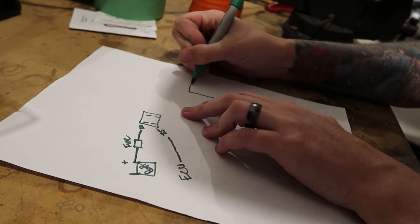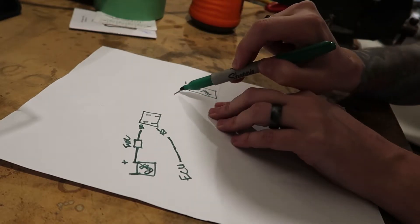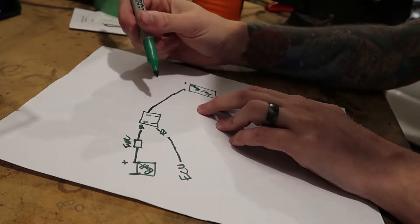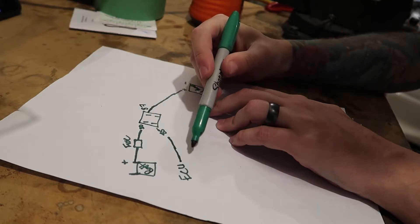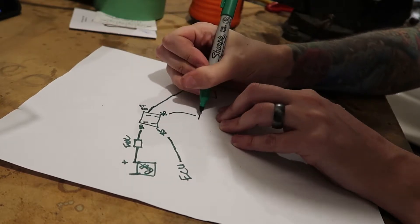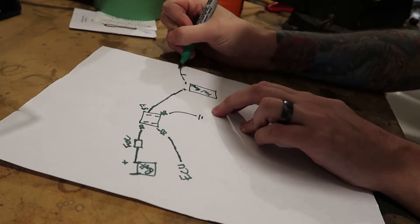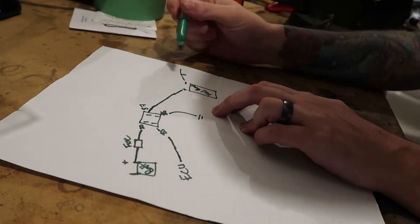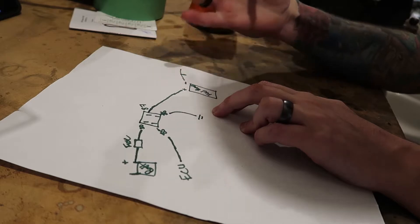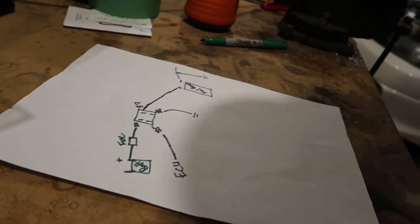Over here is the fuel pump. The cable going to the fuel pump is a light blue cable. We want to run a cable and connect it to pin 87 on the relay. Then for the ground, pin 86 on the relay just needs to go to a ground. The fuel pump already has a ground cable - you want to tee that off, leaving the original cable intact, and run an additional ground. You're just making a stronger ground. Both grounds can share the same grounding point.